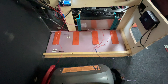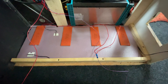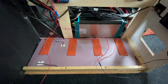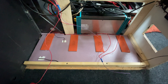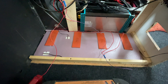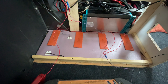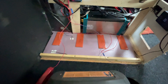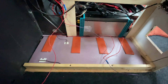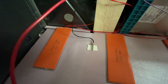I insulated the bottom of the cabinet where the battery sits and bought four little 12-volt direct-connect, 20-watt heating pads. I was going to connect them directly to a battery but something could get too warm. So I connected them in two pairs in series and found that instead of 20 watts it's down to about 9.5 watts. In outside tests they didn't get hot enough to concern me — they went somewhat above body temperature.